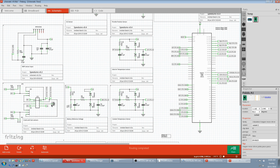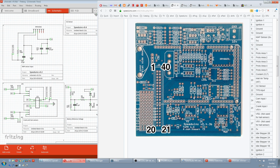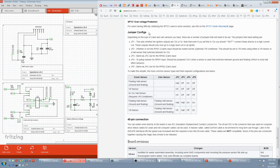Notice it goes yellow. If it doesn't trigger properly, you go to your Wiki for your board. And if we look at jumper configs, there's JP4 and 5, which are pull-up resistors to stop any ground float that might be mistriggering it. So you might have to add them to your Mega. I'll put a link to a video showing the Mega and Ardu-Stim running on their own.